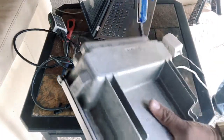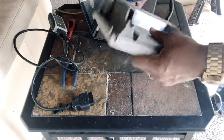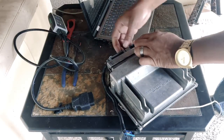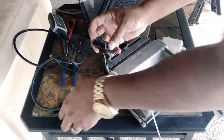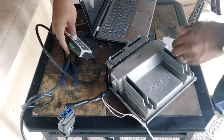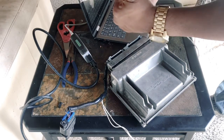Take your connector — I have to flip it over — there you go. Connect to blue and tighten that bolt right there. Take the OBD2 plug into your HP Tuners unit or any other scanning device, whatever you hook it up to, and your household plug. Tune away.